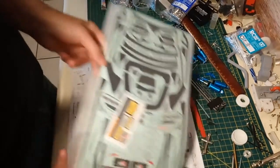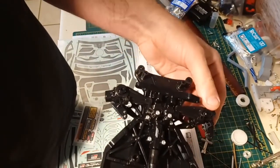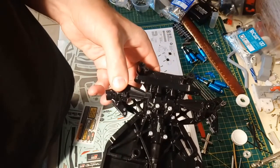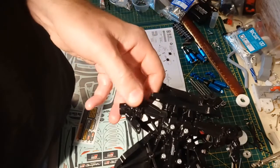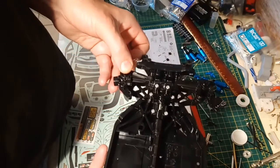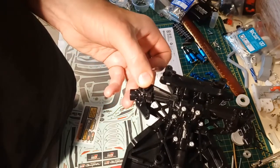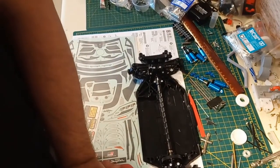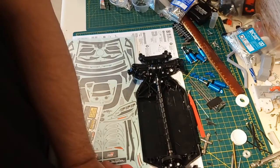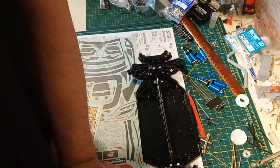The biggest downside, and I'll show you, is the plastic suspension — that's the weakest link on these cars. For a beginner, there's a little bit of play in the suspension, and the biggest play is right in these ball ends. It's a little bit frustrating because if they put metal balls in these ends it would be that much tighter. But the suspension is not that terrible, and this isn't even screwed together yet — there's just not that much play in there. The cheap Chinese cars — the WL Toys especially — out of the box, there's way more slop in the suspension than in this Tamiya. And it doesn't get better as you drive it — it gets worse.